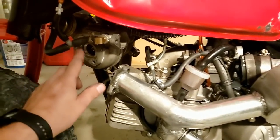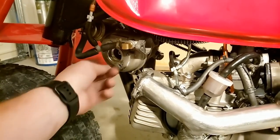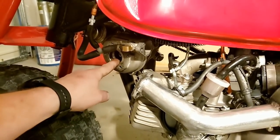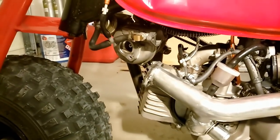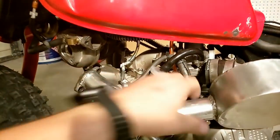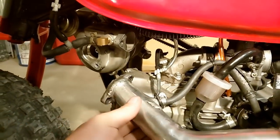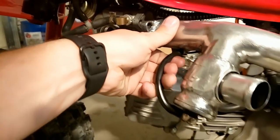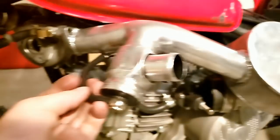This also helps even out the pulses of a single cylinder, and that is why turbo sizing is so hard. I'm actually switching this up for a GT12-38, not the 12-41 — I think the 12-38 is gonna be about right, but that's a whole other topic. The blow-off valve is tied into the charge pipe system somewhere.